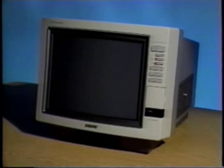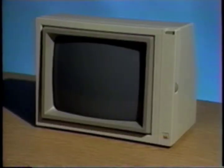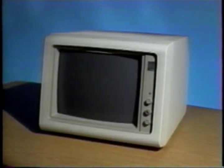Using the color switch and the composite video cable kit, a composite monitor will display both PC Transporter and Apple video. If you want to use a composite monitor, you will need to refer to the PC Transporter user's manual for instructions. You can also use a separate digital CGA compatible monitor, such as an IBM style monitor, but it will work with PC Transporter video only. Refer to the manual for further instruction on using a digital monitor with the transporter.